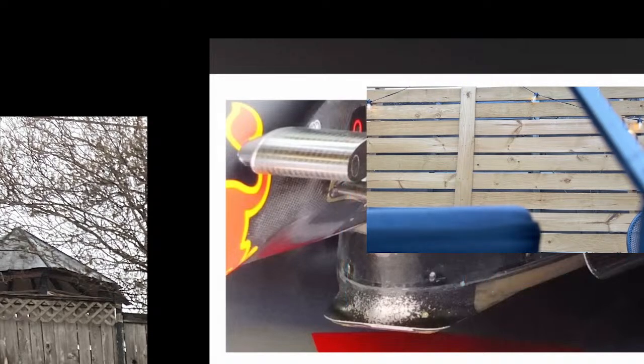It probably also indicates that their mid-body of the floor back here is probably also close out to legality, which will give you a decent amount of floor planform that would be right at the minimum legal limit, and that should be able to generate quite a lot of suction, particularly when you're at lower ride heights.